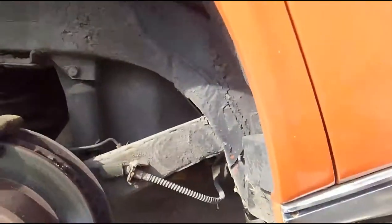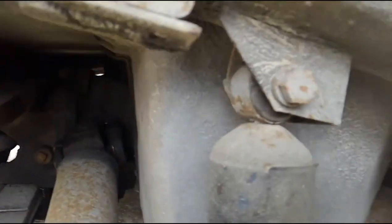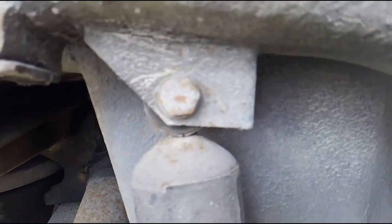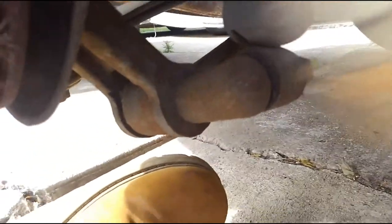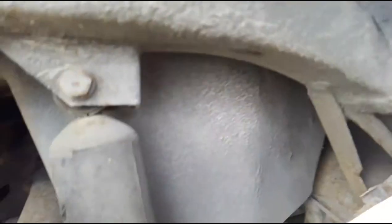Okay, I'm back. As you can see, you've actually got pretty good access to this shock right here. Here's your upper mount. Come around to the backside — that's a three-quarter and five-eighths on the front. On the bottom you've got a seven-eighths that holds that lower mount in. Basically all you do is take those two bolts out and this whole thing comes right out. These have been in here for a long time.